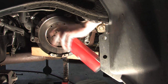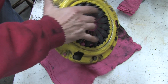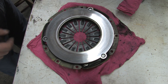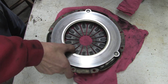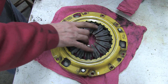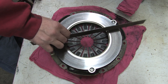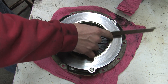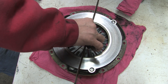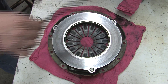Here's a pressure plate. There are plenty of reputable brands out there — they all build them differently and some work better on some cars than others. A pressure plate that's missing fingers is junk. You want to check the pressure plate for flatness with a straight edge, make sure it's not concave. Typically as a DSM clutch wears, it wears toward the inside edge, and you can tell exactly how far gone it is by measuring across its face.